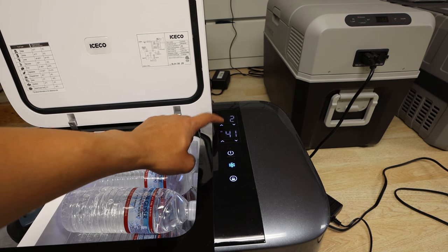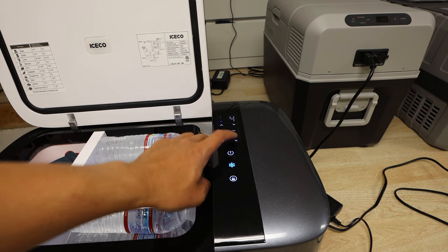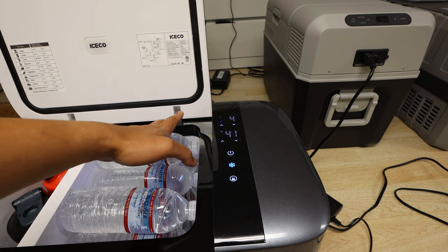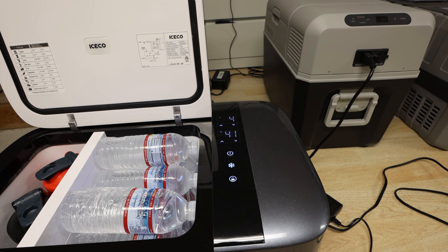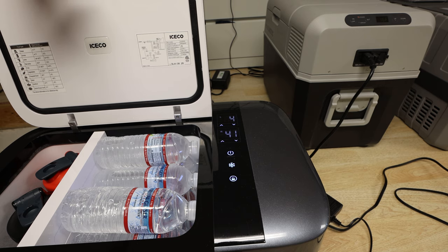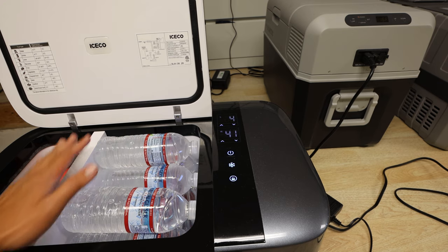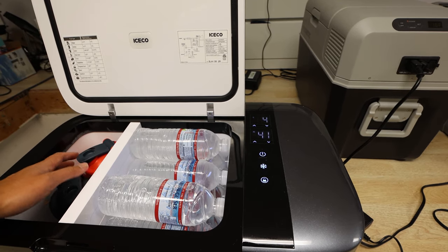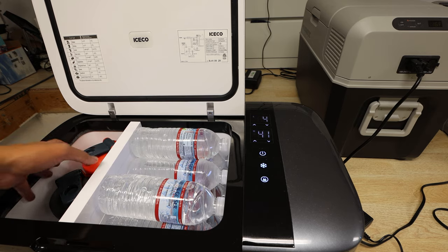You can adjust temperature freely; this is set in Fahrenheit, by the way. On the right side, I have this set at 35, and once it stops blinking, that is the current temperature. I'm going to turn the quick freeze off since I don't want to put unnecessary wear and tear on the compressor. Obviously, when you want to use quick freeze is if you didn't pre-cool the fridge freezer and you need to freeze popsicles or ice cream — turn it on and put it on quick freeze so it doesn't melt on you.